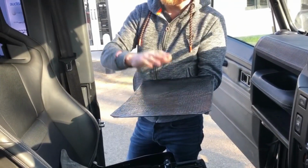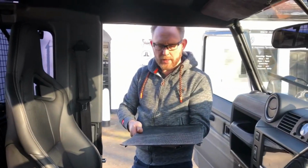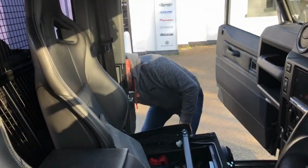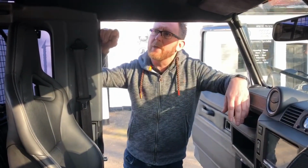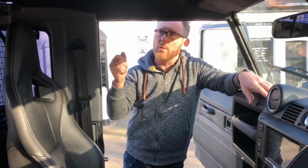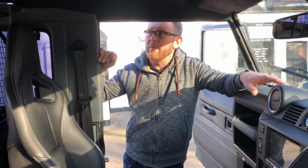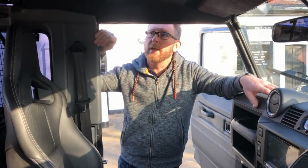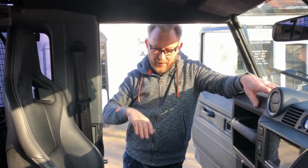One of the problems we found as we stripped the car down is that the glue had failed, which often happens with a cheaper product. So particularly in the roof, we had to remove some of the stuff that had peeled really badly. The stuff that had just lost its sticky, we had to treat with a heat gun and then re-roller. Now, although this vehicle had apparently been fully soundproofed, there was no foam product in it whatsoever, so you've only got one layer of treatment. So over this sort of thin soundproofing in the roof, we've then added our 6mm foam.